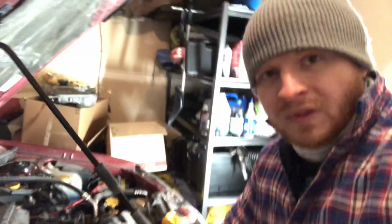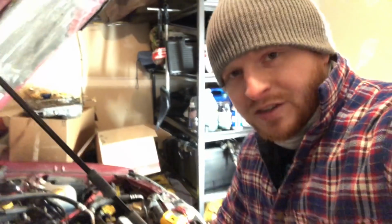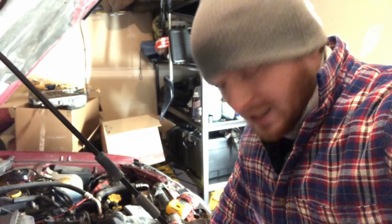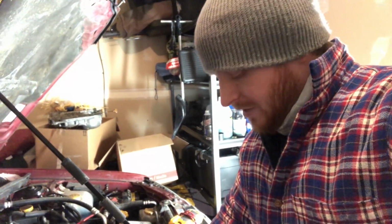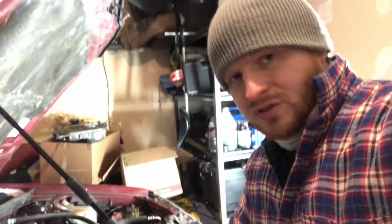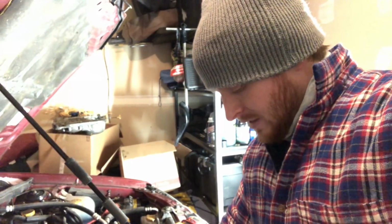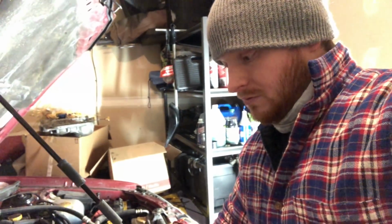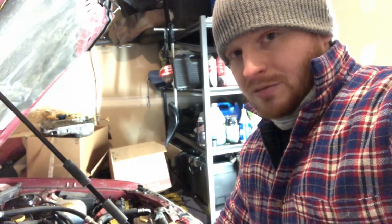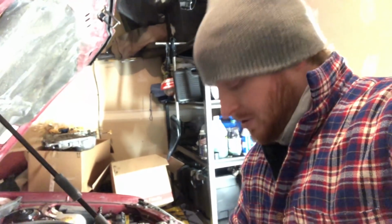So I've been having issues with the brakes on this. The brake light is always on, and the ABS light is always on. Whenever you have any kind of slippery surface and you use the brakes, the rears lock up a lot sooner than the front, and since it's slippery, you just spin out. Like, the momentum of the car is going forward, push on the brakes, the rear brakes lock, and so the back end comes around. Super dangerous.